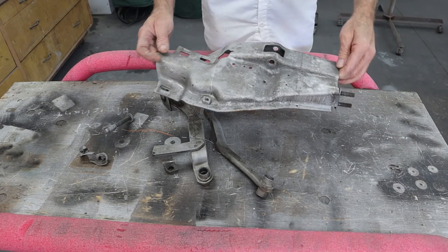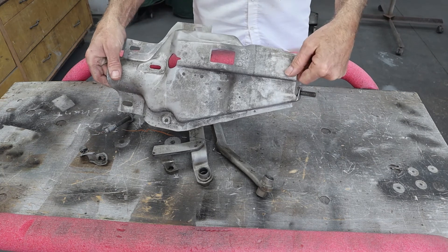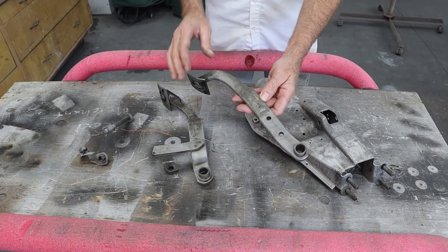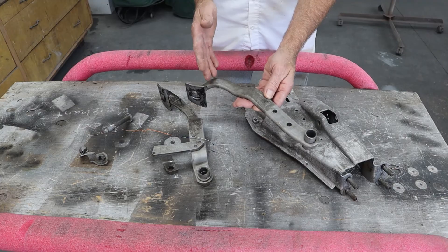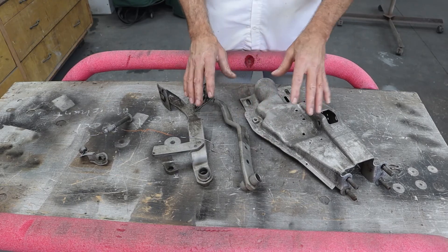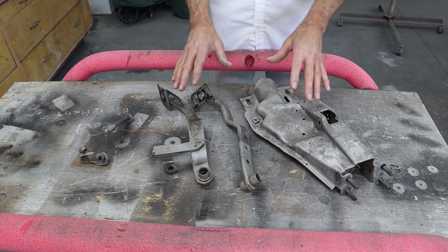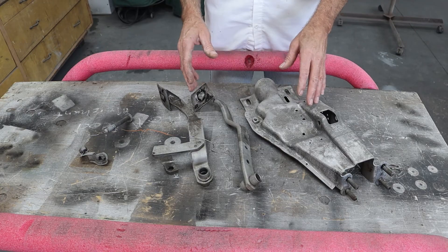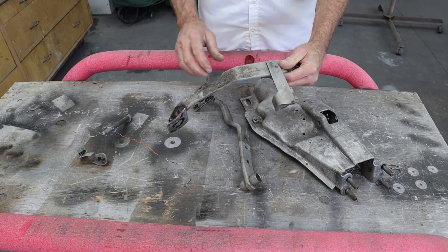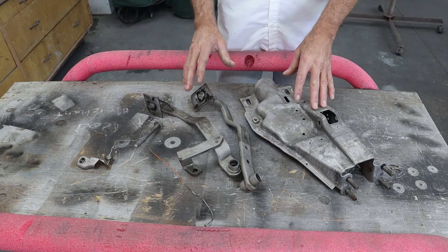Came up pretty nice. It's got some staining on here, but that's not rust — so I don't care. You guys remember what it looked like before, so I'm really happy the way everything came out. It looks fantastic. Pedals came out nice, really nice. Now there was some sort of black spray paint — I probably spray painted it when I was a kid — and that did affect that paint. I don't know if hitting it with the pressure washer would have taken the paint off just the same, but it did come off; it seemed to kind of dissolve it a little bit. So I'm not sure the solution is safe for something that's partially painted and partially rusted if you want to save the paint — you'd probably have to do a little trial and error on that. Anything I'm throwing in that bucket I don't care about the paint on — it's going to get repainted. Small parts came out really good, no problem there.